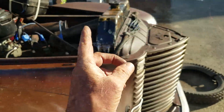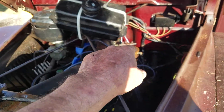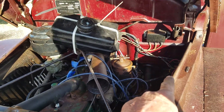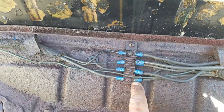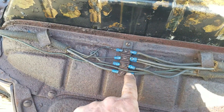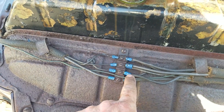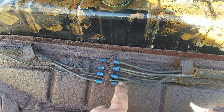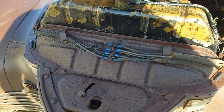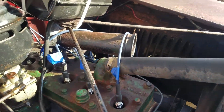The main thing with the power was that the main power is supposed to come off of that starter. But ours goes down to the battery and it had a couple of crimp connections like these. And when these get a little bit corroded, they won't work properly. So it got corroded, I didn't get enough juice. I cut them off, put on new ones, fired right up.